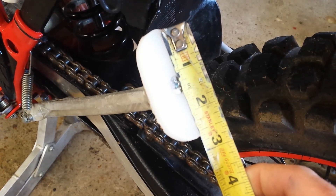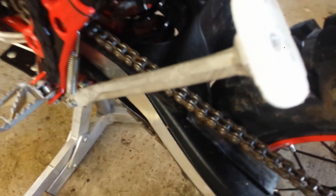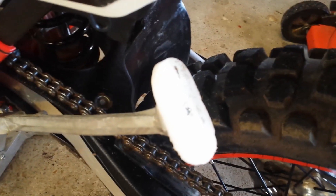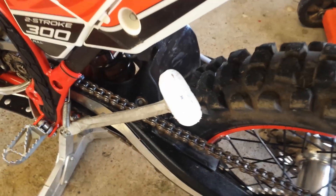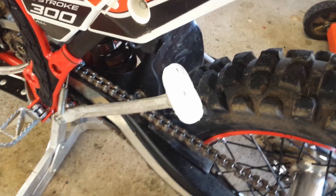A little over two, two and a half by inch and a half. I drilled and tapped a six millimeter bolt hole, countersunk hole into my kickstand. Put a washer underneath it because there's a little recess in the kickstand, then used some red Loctite, screwed it on, and this thing worked like a champ. It's actually designed so that in a big get-off it will break away if needed — designed really not to become a weapon, more to just do its job when it can.